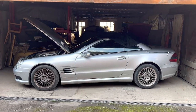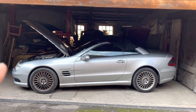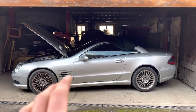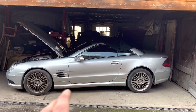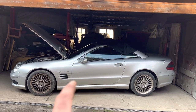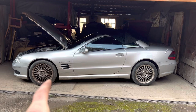This video is all about measuring and topping up both the engine oil and the transmission oil on one of these R230s. This is an SL55 AMG. The transmissions or gearboxes in these cars are supposed to be sealed for life, but in reality after anywhere between 50 to 75,000 miles you should probably change the gearbox oil. When you take it out you'll notice it's no longer that bright red colour — in worst case scenario it's brown or black if your oil is burnt.